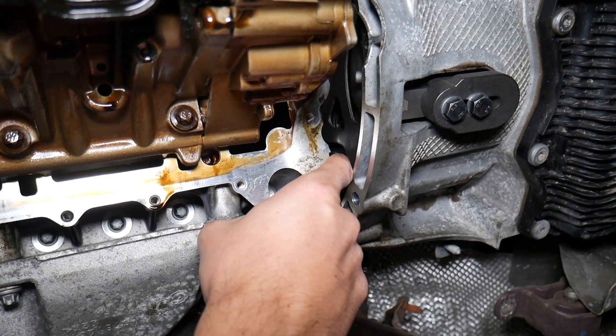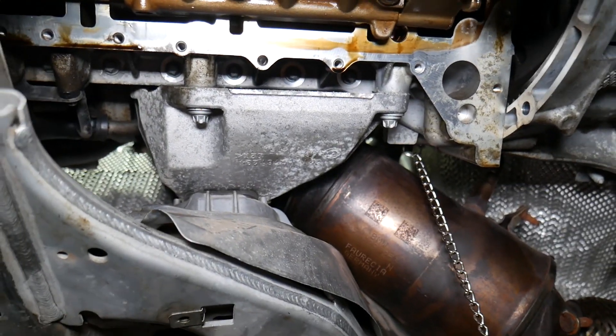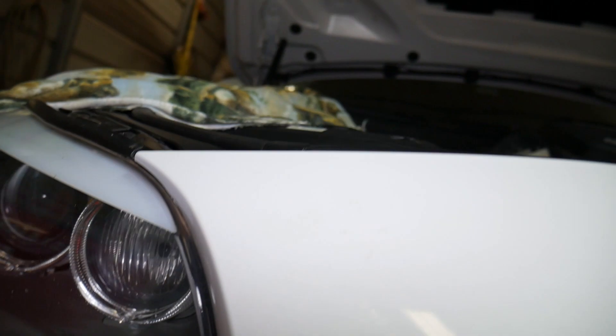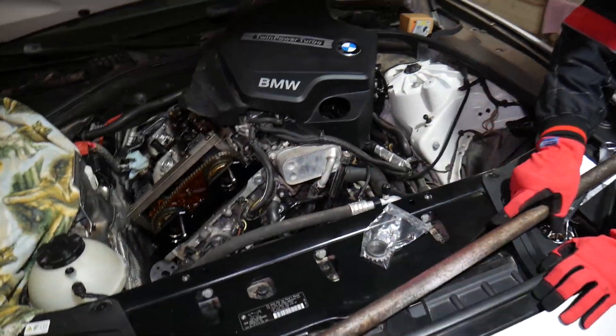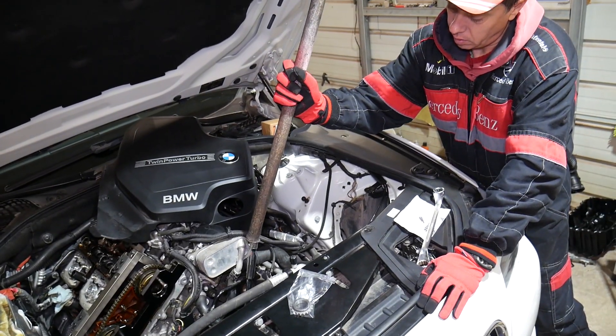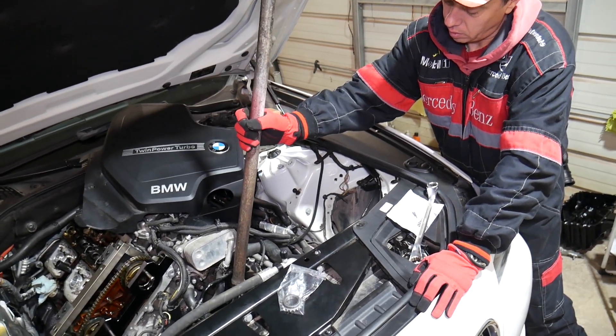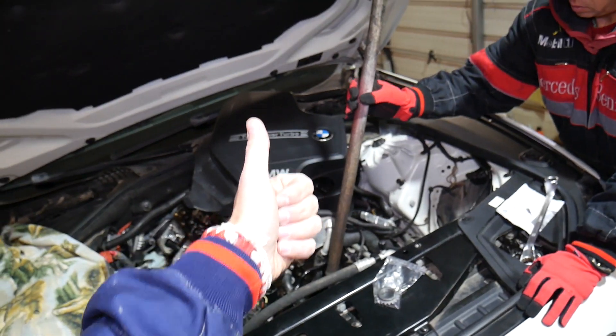Verify you can see the hole for the TDC pin and make sure you push it back in before you do anything else — confirm it didn't move at all so you don't mess up your engine. At that point, you come on top with a big pipe — and I mean a huge pipe — it'll take a lot of effort, and just get it loose. Hopefully this video will be helpful to any of you trying to do that. Thank you for watching and see you next time.